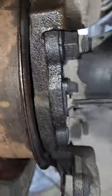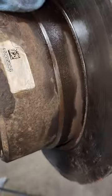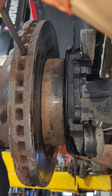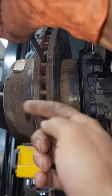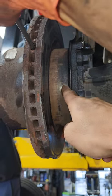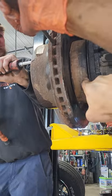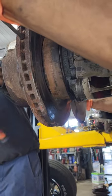What we're doing is pulling them and pushing on them with a screwdriver. If we just force it off, it pulls the shoe so hard that it bends the backing plate or ruins the hardware. What he's doing is chasing it by forcing the shoes through — they aren't unadjusted all the way.